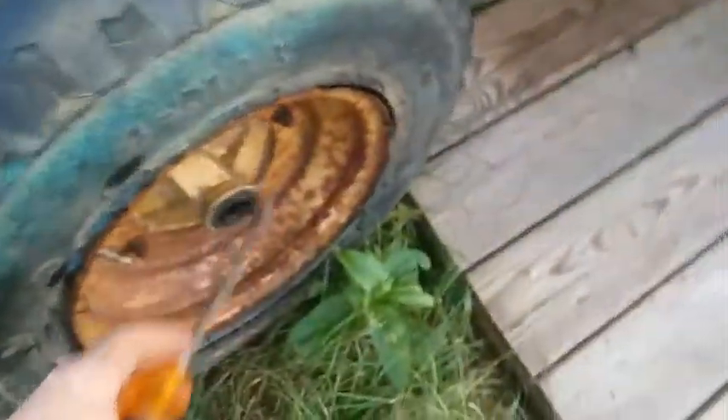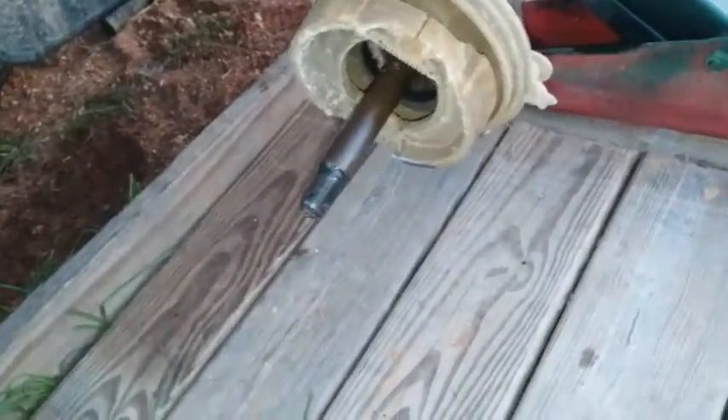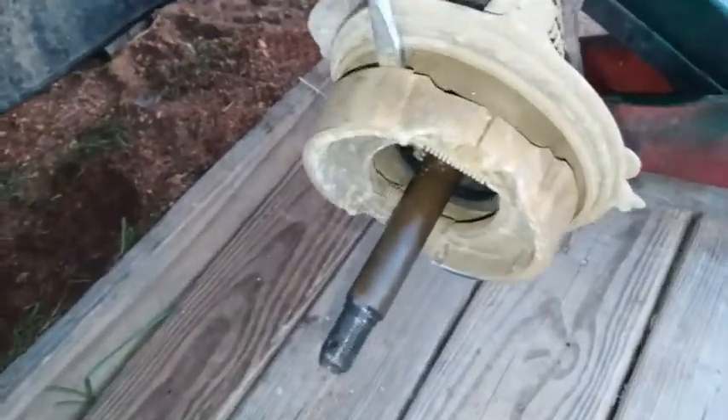This right here is the wheel and hub. You can see these are the brakes — they're very tiny brake pads. You can also see this isn't a tapered shaft, so when the wheel bearing wears out it just wears out. This came off fairly easy. I'm probably going to sand down that drum a little bit to get the new brake pads to fit in.